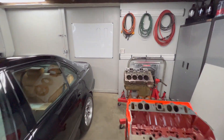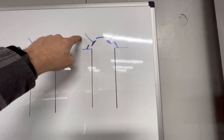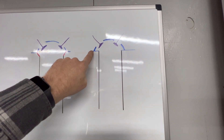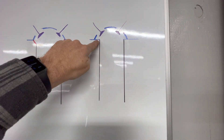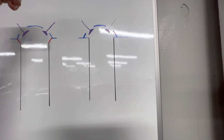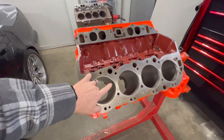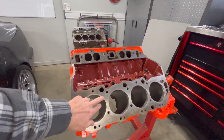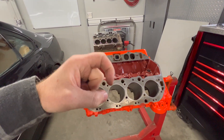As I've shown here in this quick picture, you can see that this represents the intake valve, this represents the deck, and we actually have the combustion chamber overhanging. So the airflow is going to come in and hit that deck right there — not only creating turbulence, but it's just an airflow restriction. You'll notice on some factory big blocks that they actually have notching on the side for the intake valves, where they notch onto the deck surface into the cylinder — like a small little C-cut that's in there.